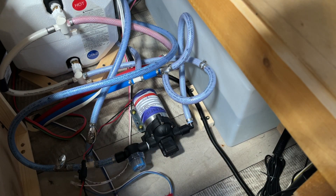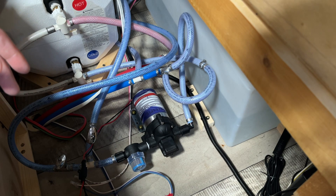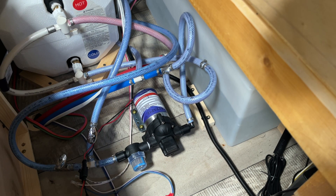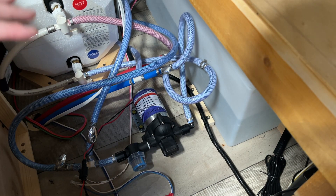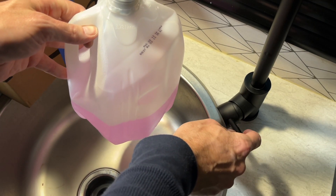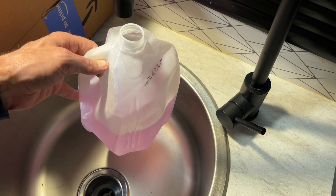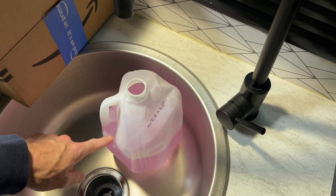I have the fresh water tank about half full. I've turned the pump on and it did cycle, so it has pressure, but there is air in the lines right now. I'm going to turn on a faucet and purge some of that air — the pump should kick on and off. I'll point the microphone towards it so you can listen to it. The pump just cycled. I'm going to leave this under pressure for a bit and come back to check for leaks. Here at the sink — I'll turn this on. The pump just kicked on, you can see the water flow, and it just kicked off. I'd say that was a success. You can see this is a little pink — I have some antifreeze in here that I need to flush out of the system.